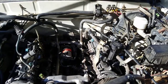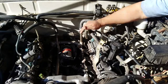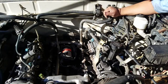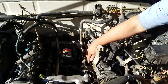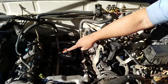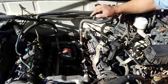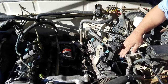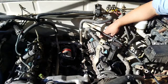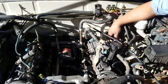So here's what I've done so far: I removed the plenum, so you can see everything exposed here. What I'm going to do now is block off the intake manifold using duct tape so that nothing falls into it. After that, I'm going to remove the coil here and start removing the head. I'll speed this up so you can see what I'm doing.